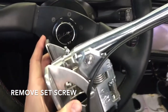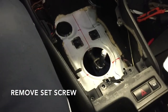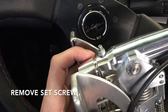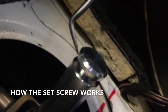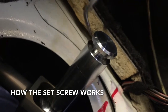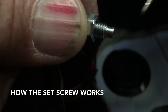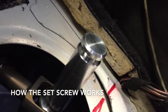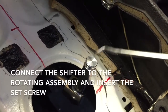Now you're going to want to remove the set screw so you can slide the lever onto the lower rotating assembly. Go ahead and remove that with your finger and be sure not to move the position of the nut, because that's going to be the setting position when you tighten it down final. Before you slide the shifter in, take note of the small groove that's on top of the lower rotating assembly — that is where the little dog of the set screw inserts, and that is what's going to hold your lever onto your lower rotating assembly.